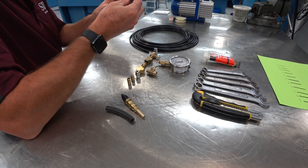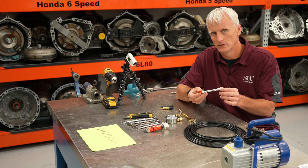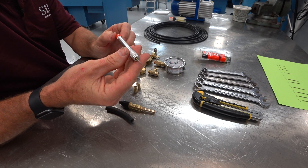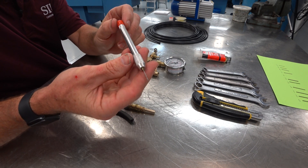So when I bought this stuff, I bought it with the intent of not only doing vacuum testing, but also for line pressure testing using these same components. The key is to make sure it's compatible with the fluids and the oil, and that it can handle pressure — this one was spec'd at 300 psi. Most of them you'll see at 100 or 125 psi, so you actually have to look for that spec. Another thing you're going to need to buy is this welding tip cleaner — the type that uses drill bits — because we're going to use these drill bits to create an orifice.